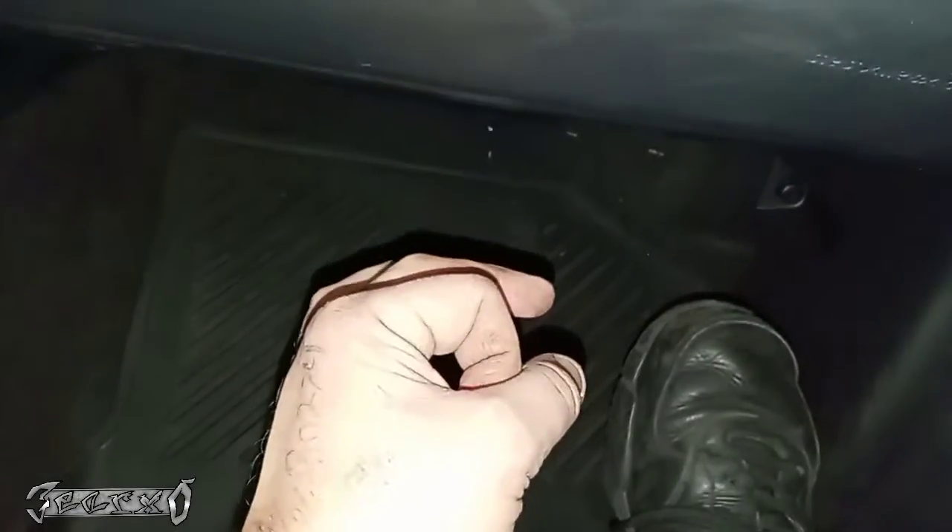Now if you're having noise and you can't get it all cleaned out, you could probably drop the blower motor from under here — this little panel can come off and your blower motor has like three little screw bolts holding it on. You could drop it down and dump it out, spray it with disinfectant or air sanitizer. I have other videos on Tacomas and 4Runners on how to do that — pretty much the exact same premise. Toyota tutorials are very similar. Thanks for watching — I'll throw that part number right here on the video.